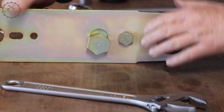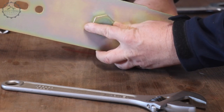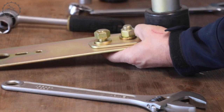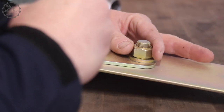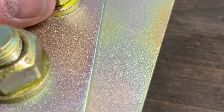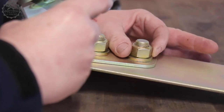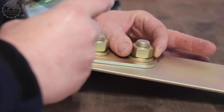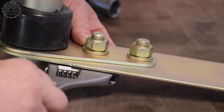This eccentric bolt shifts the body side part of the suspension towards the suspension sword and therefore adjusts the height of the car over ground. I mean, look at it. I scratched a mark into it before I separated the parts in order to find a semi-decent starting position for the overall suspension settings. Given the already epic proportions of this film project, the fine-tuning needs to be postponed to a separate film.